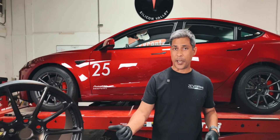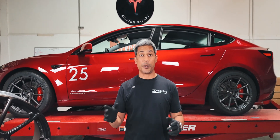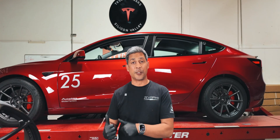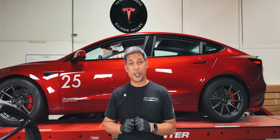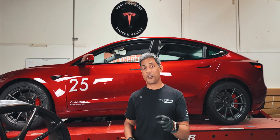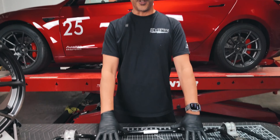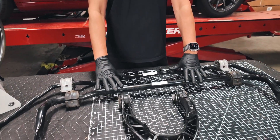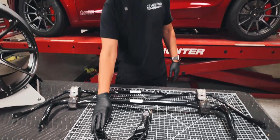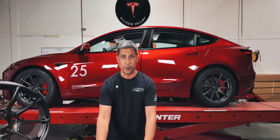We're going to try and test fit this — this is the Spira AF10, 18x10.5 in a +35 offset. This wheel did require a spacer on the older platform in order to clear the knuckle. Keep in mind, this vehicle does have two-piece rotors now, so it's as if it's already simulated a 5mm spacer. We will also attempt to test fit the 20x10 warp wheel with the 275 up front and see how that fits. So these are a couple of the sway bars from the older Model 3 Performance — the older platform. This is the Highland 2024 Performance upper control arm, but I will show you guys the older platform upper control arm too — the bushings look a little bit different.